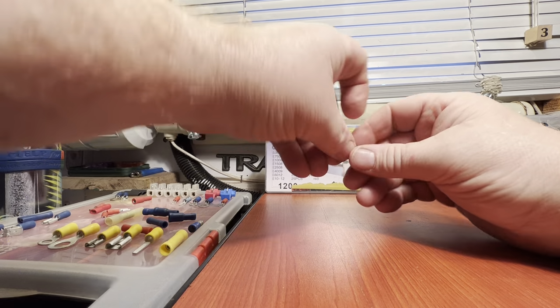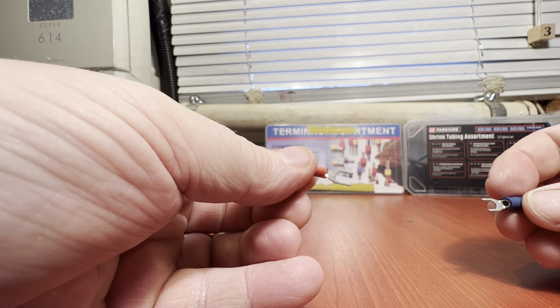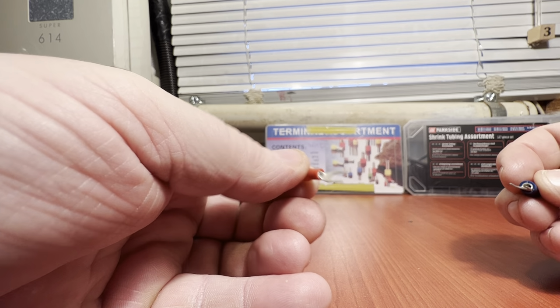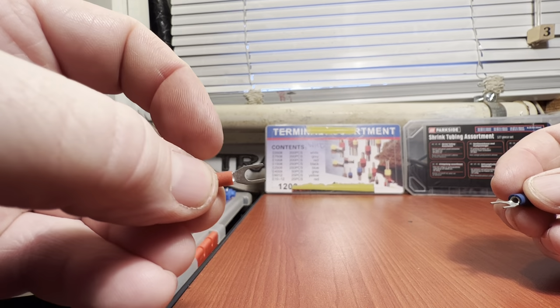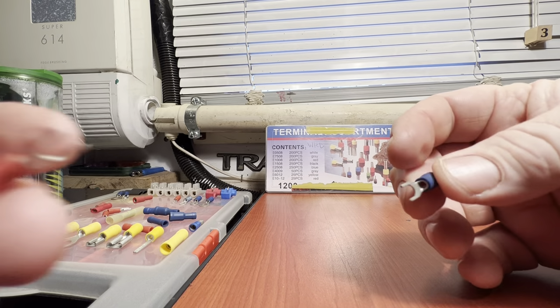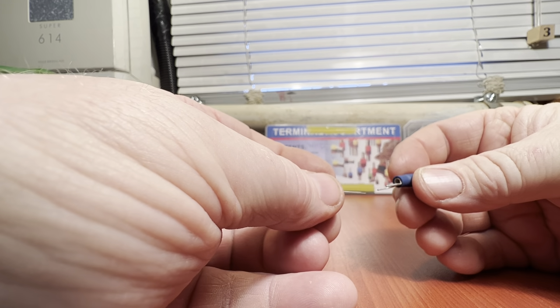These ones, one and two, are for if you've got something with a screw on it, a terminal. You don't need to take the screw right out, guys. You just slacken the screw a wee bit, right? And it being like a fork, it just slides in and under the screw, and then tighten your screw back down. Now that's red for live and blue for neutral, or whatever you want to call it, as I say. So that's so you didn't have to take the screws right out, okay?